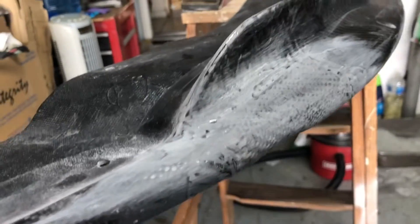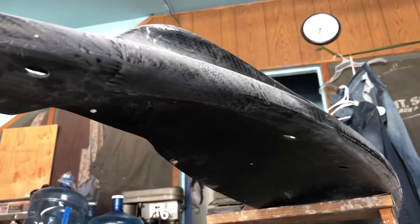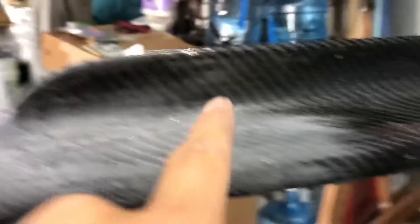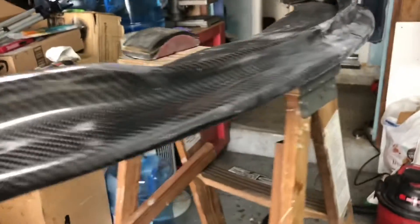Now that that's sitting and curing — instructions say about 20 hours — I'll have to wait till tomorrow. I only did that little patch just to test it out. I'll end up using all the carbon fiber and had to order another whole roll. All right guys, we're back the next day. I forgot to record before I started sanding, but here's how it looks right now. It dried up real hard, feels like normal carbon fiber. If you guys remember what it looked like before, there was a big old crack right there — now it's gone. Just gotta blend it in, put epoxy over it again, and keep repeating those steps for the rest.